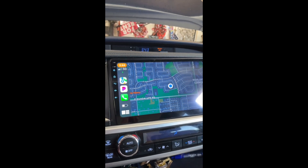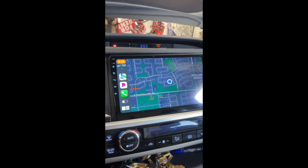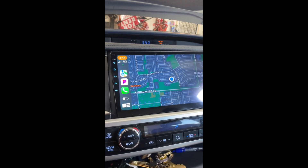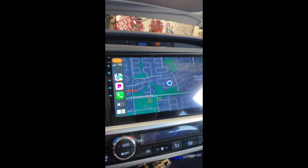If you have a stronger Wi-Fi signal in the house than the Android signal, it will confuse it and it won't connect to CarPlay until you drive far enough down the street — then it will connect.